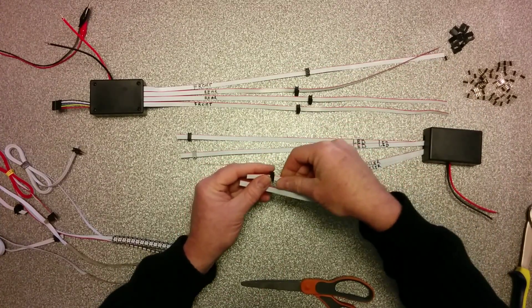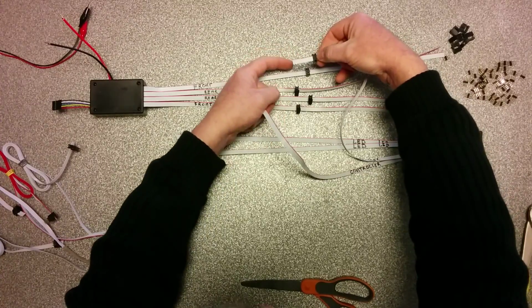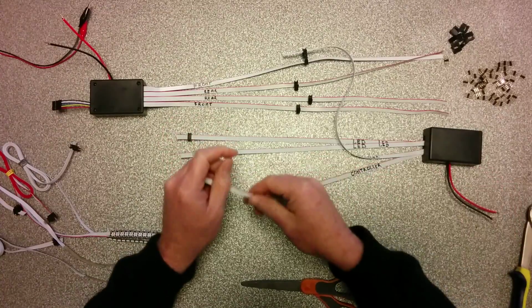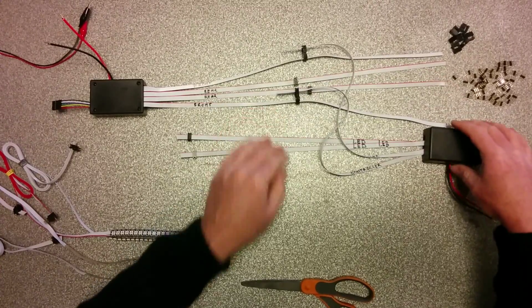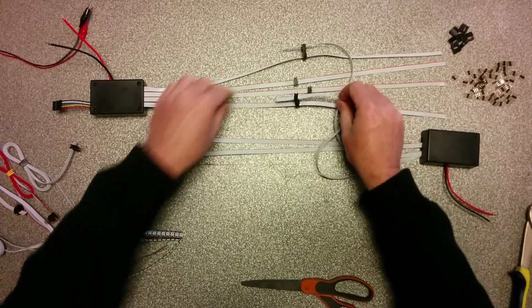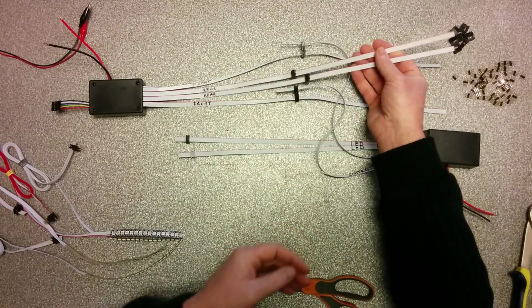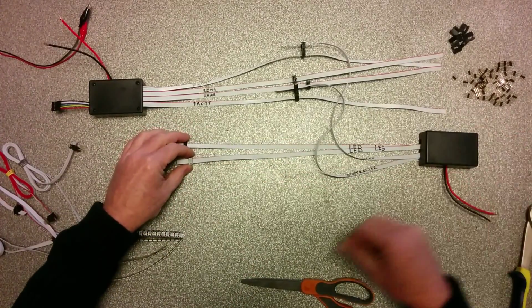Usually we put the amplifier in the front. So I already installed the pins. Colored line, same side. So the front is now connected to the wire marked controller of the amplifier. This is the other one, and I do it to the other front wire. So the amplifier now is connected to the controller. That means the rear LEDs will go directly to the controller, to the wires marked rear, and the LEDs in the front will go on the lines marked LED, LED from the amplifier.